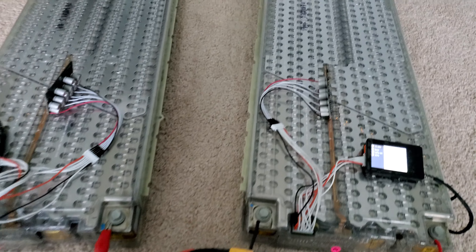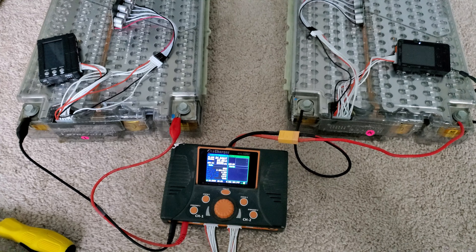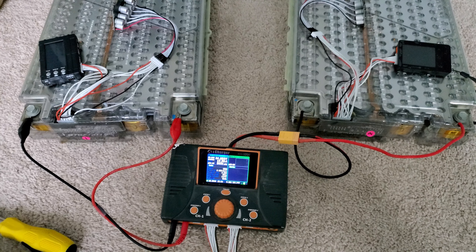Here we're pulling 20 amps out and there we're pushing 20 amps in. I'll probably charge these cells to 4.1 volts — I've left 18650 cells at 4.1 and they seem to stay there well. I do actively use my golf cart, which matters a lot. You could potentially charge these to maximum if you use your golf cart every single day.